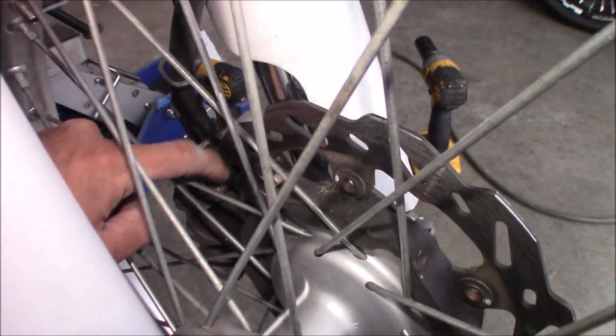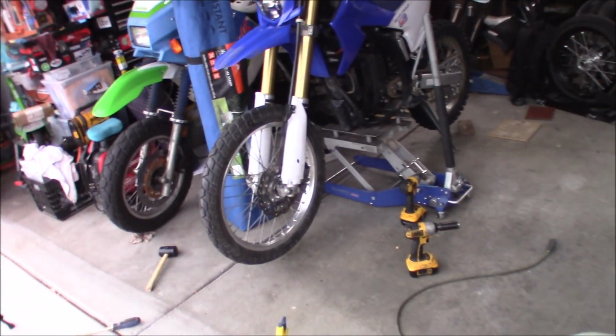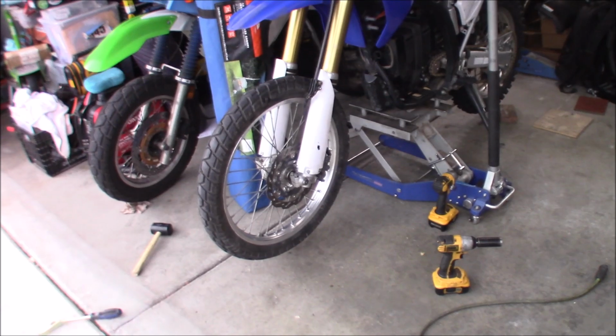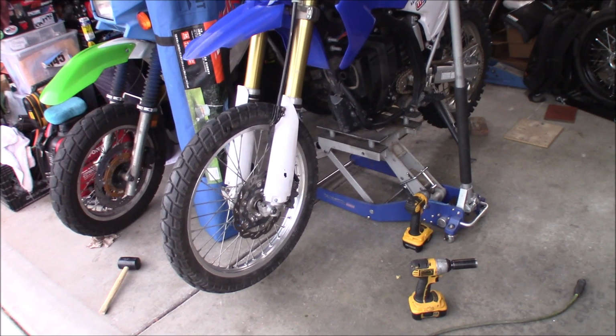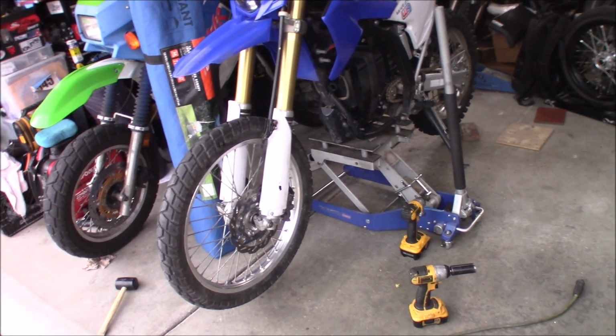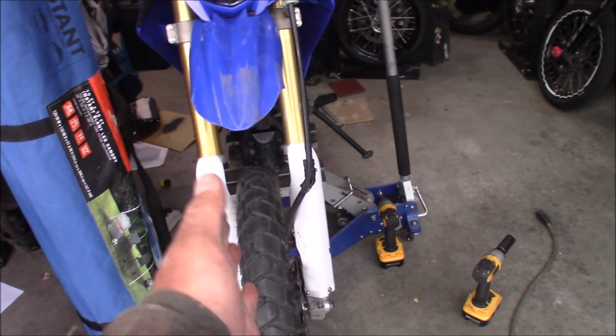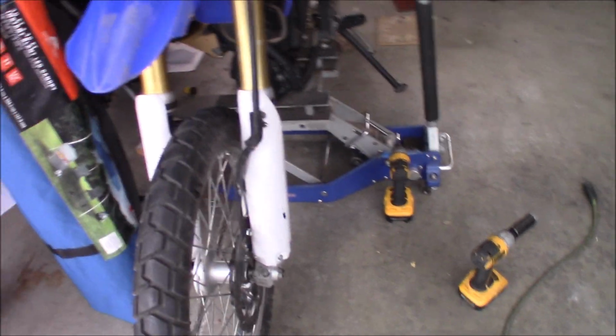Okay, and now there's a much bigger gap right here. So there you go. There's no doubt in my mind that that drag on the front wheel is probably chomping at our range. If the wheel doesn't roll smoothly, then that means it's working against us, and it's making the motor work harder than it should. It should probably brake better now. It's probably properly aligned. It should handle better too, since I'm pretty sure it shifted the wheel. It shifted the wheel in more. Okay, so yeah, that was the problem, guys.